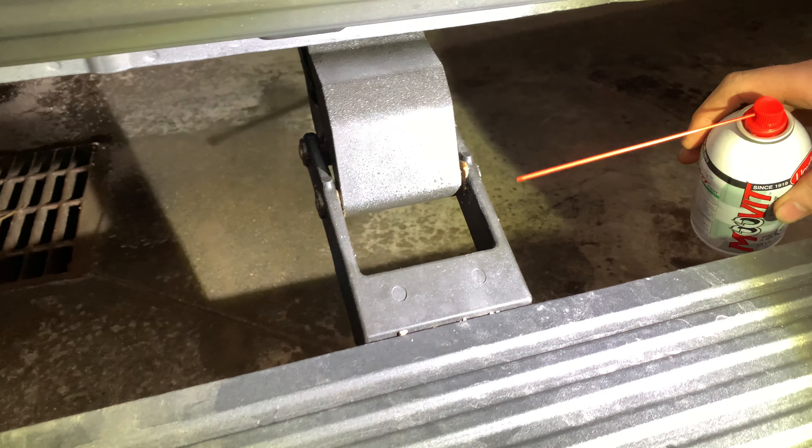What you can do — and I've seen this done before — when the truck's out of warranty and this starts happening, the only real fix is to replace the whole assembly. But the thing's so expensive. Well, you can actually press these pins out, clean everything up, lubricate them, and press them back together. They're just a press fit — there are no clips or anything.